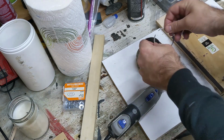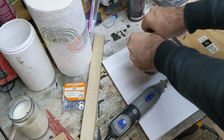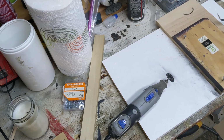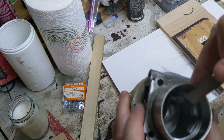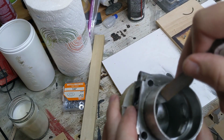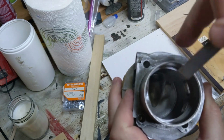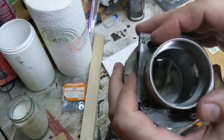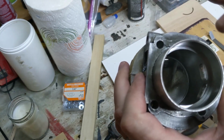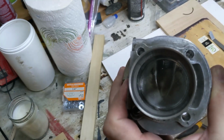Just a little bit. Put the ring back in. Bring it over to my piston. Push it in. Measure again. Right there. All right, so that right there is spot on perfect. Okay, so that's only half of the battle. That's just getting the ring gap squared. What we have to do now is take another bit, and I have to round out the backside because that's where the indexing pin on the piston goes.